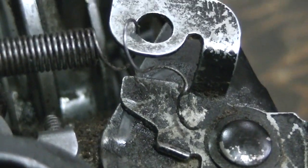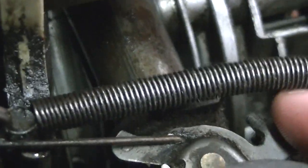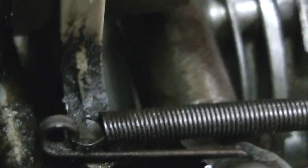You can see I've made this spring a little bit tighter. As you've seen in the last video, I was bypassing the governor while it was running and giving it complete full throttle, which isn't good for these engines.